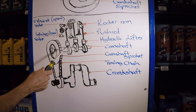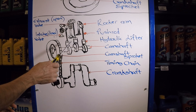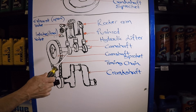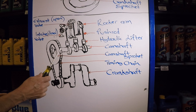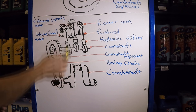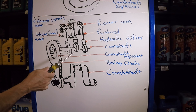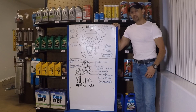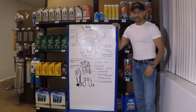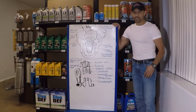In order not to drag this video on forever, I'm going to leave it at that — this topic alone could take all day if we get into the details. On the next video I'm going to explain how the overhead camshaft design operates, which is completely different. This is just one camshaft in the center of the engine operating every single valve through push rods; the other setup is entirely different. So there you go — now you understand how the single camshaft design operates. Stay tuned for the next video, which will explain how the overhead camshaft design works. If you drive a vehicle made recently, it's very likely it's going to have an overhead camshaft.